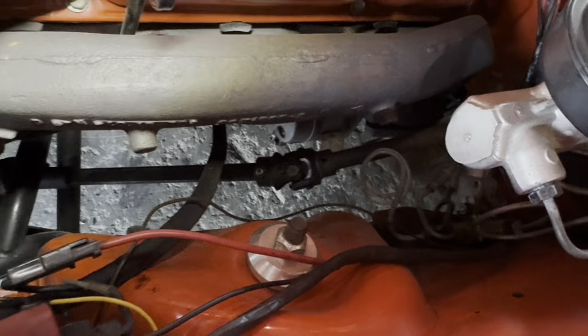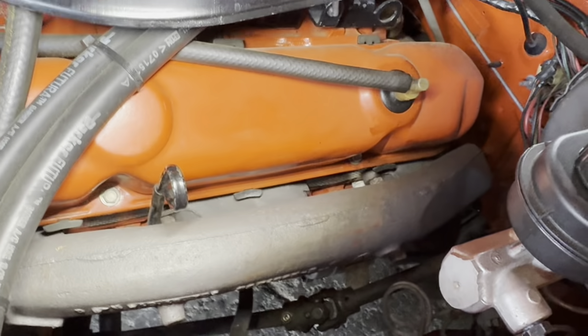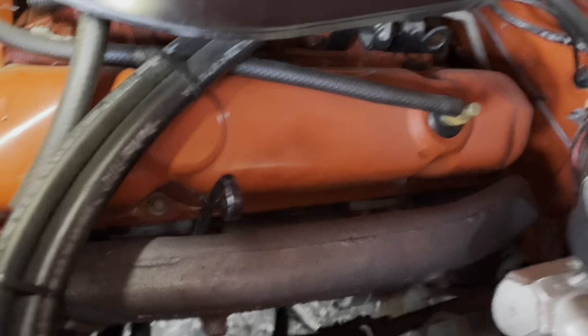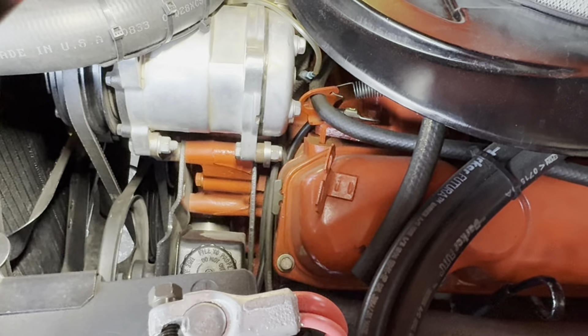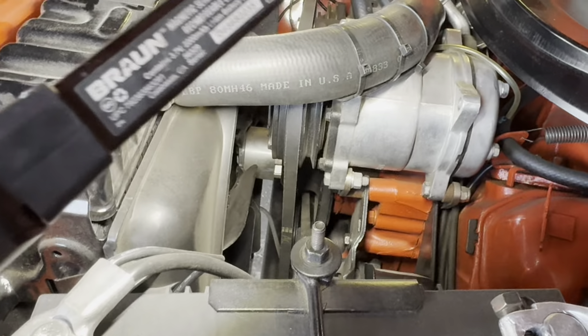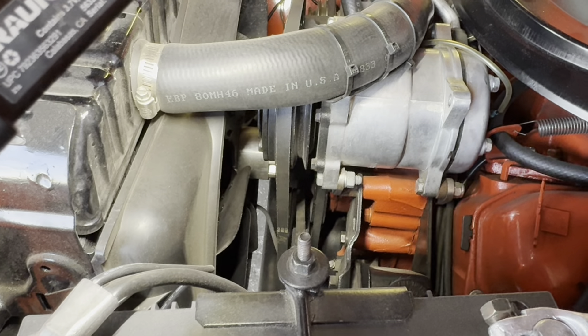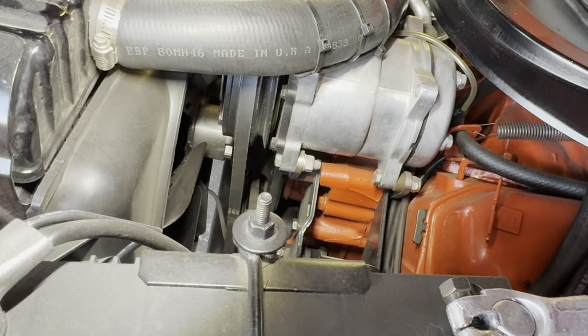On the front suspension they have a really goofy steering column - I don't know if they cut the original one, but I really hope there's still a collapsible part of it because that's kind of dangerous. They have to have a special column like that to make all the rack-and-pinion stuff work. Nothing major, just a bunch of little stuff that bothers me. Pretty sure that's the wrong valve cover. It doesn't have a clutch fan either - it's a solid fan, which loses about five horsepower versus a clutch fan, and this should have a clutch fan.